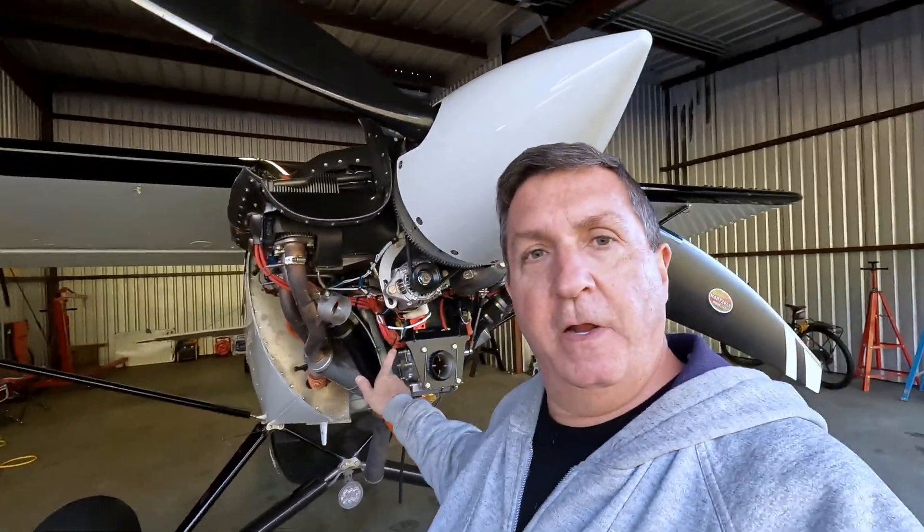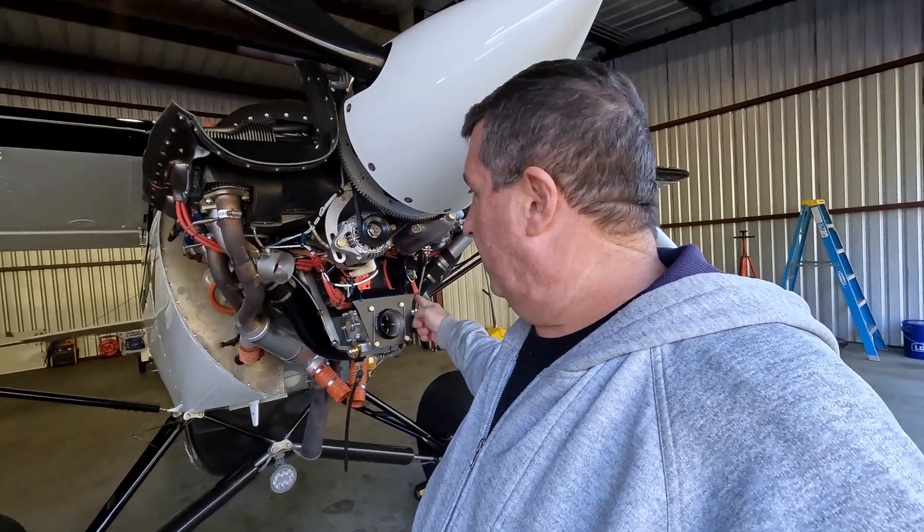What I did first was take the right ignition coil pack from cylinders three and four and move it over to one and two — just swapped them — and verified the problem followed the coil pack. I emailed Cub Crafters for replacement coil packs and they were back-ordered four to six weeks. A pretty critical component that seems to be a high failure item. A friend of mine about six months ahead of me with his FX3 just went through a coil pack replacement as well. Klaus admitted he's having a quality issue and has had to send some back to his supplier. So I emailed LightSpeed directly — Klaus said he had plenty and to give him a call and a credit card number. I ordered three of them and all three new ones are now on.